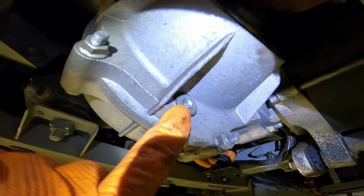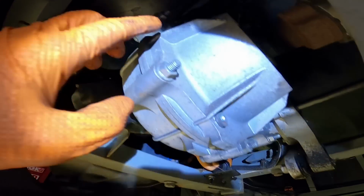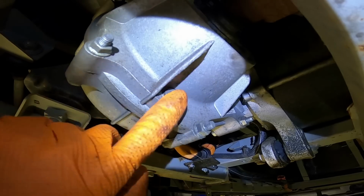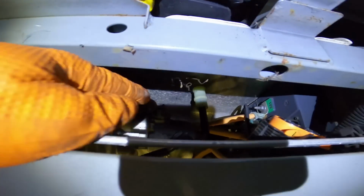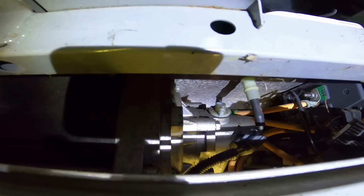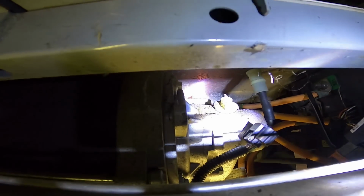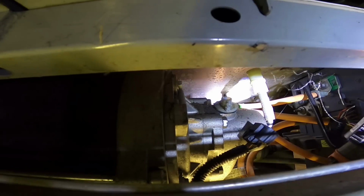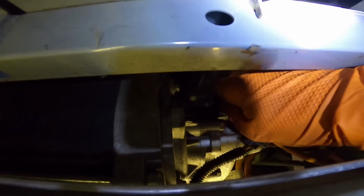This is the drain plug here, and then this is the level plug here. From what I'm aware, technically what you need to do is drain the oil out of that one, take the level plug out, and then fill it through that fill plug at the top. Let's try and zoom in on it. That little plastic thumb screw is a lot easier while the battery's out. If the battery's in, you need to strip down the inside of the car and use a really weird funnel.